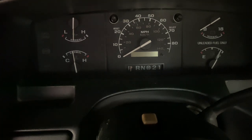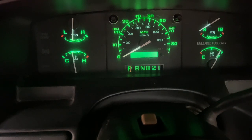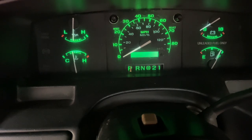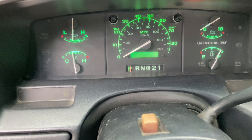I've got everything hooked up and put back together — moment of truth. Oh yeah, that looks awesome. If you picture your usual incandescent bulbs, you can tell this is way brighter and it just looks so cool. It kind of adds a little extra something when you're driving — you feel like you're driving a newer truck with a nice LED backlit cluster. It's a pretty simple procedure to change out those bulbs: just pull the dash out, be real gentle with everything, and click the new bulbs in. I'm Stevie from the Minute Masters — subscribe, check out my other videos, and thanks for watching.